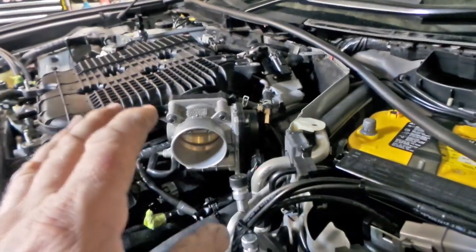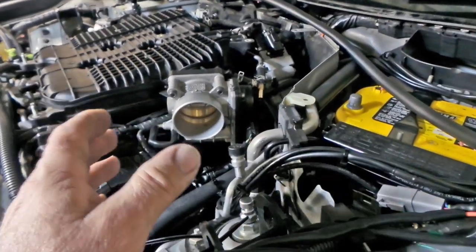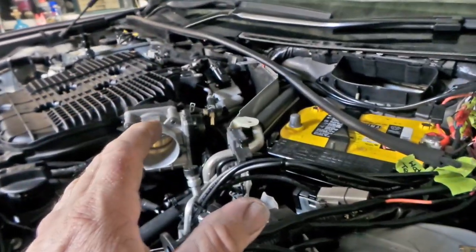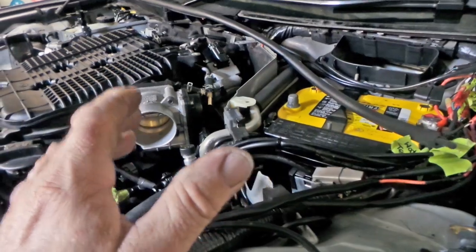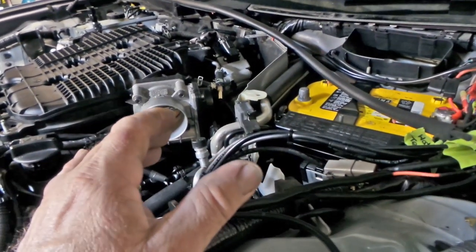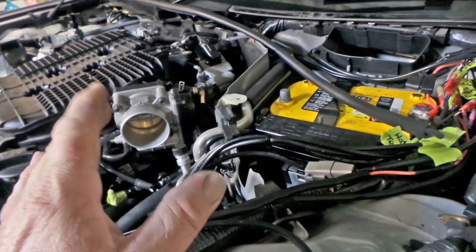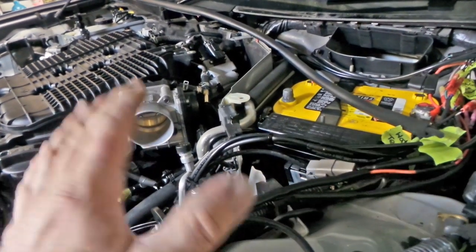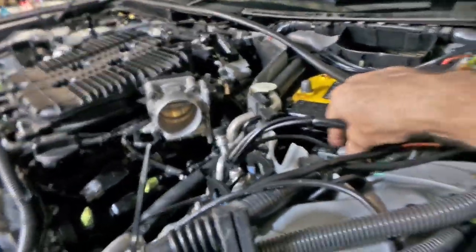The passenger side turbo dump pipe on this side, up underneath, has a Bosch wideband oxygen sensor, and that's obviously the wiring for it that goes back to my PLX gauge system and also runs to the boost controller, because the boost controller that I'm using, a GFB, also monitors the richness and leanness of the engine and will do a boost cut, or will switch off the boost controller, if it comes up lean on the O2 sensor. Not a bad way of integrating O2 capability into the boost system. So, as I say, Deutsch connector in that for that.